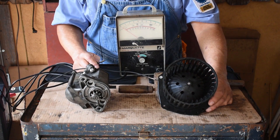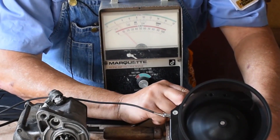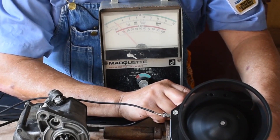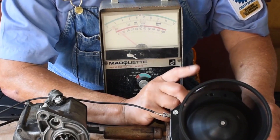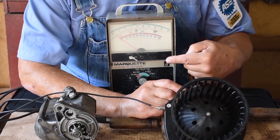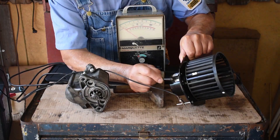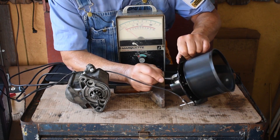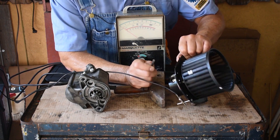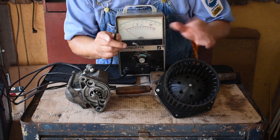Don't take my word for it — let's measure it. On that red scale, how many amps is that? You hear it? That is high speed. I think we were about 10 on the meter. Do you remember the spark? Let me remind you of the spark. I'm not afraid of getting electrocuted, it does get a little bit warm. If maximum speed takes 10 amps, the other speeds take less.